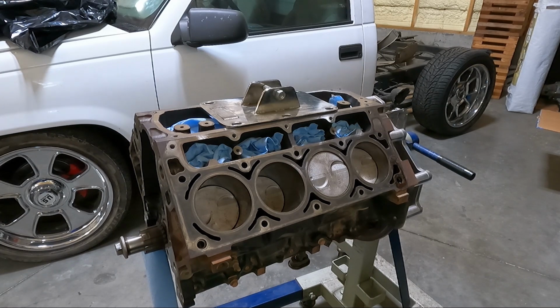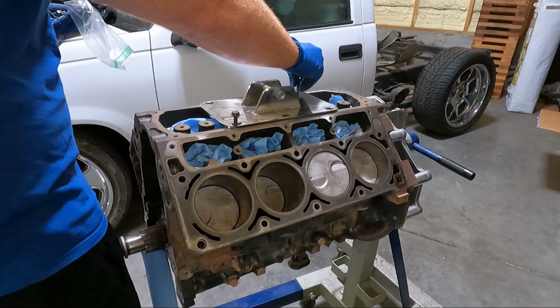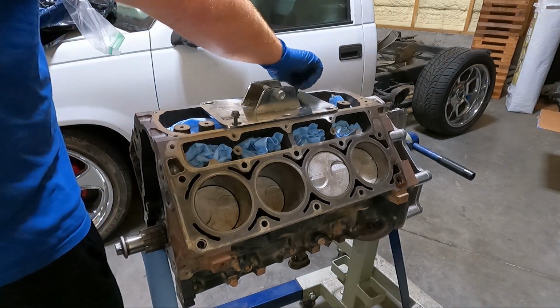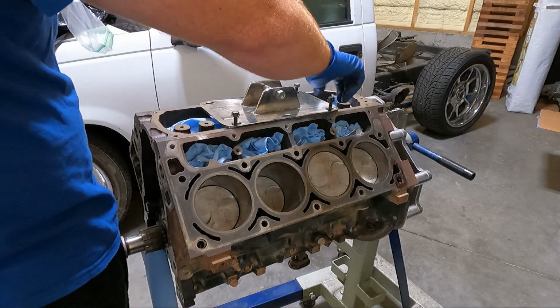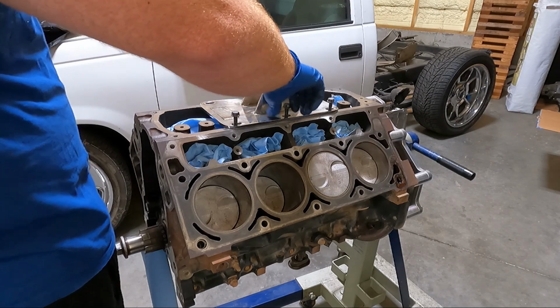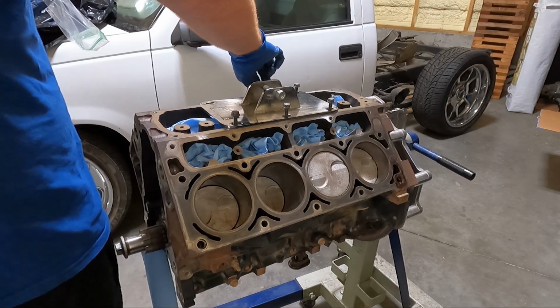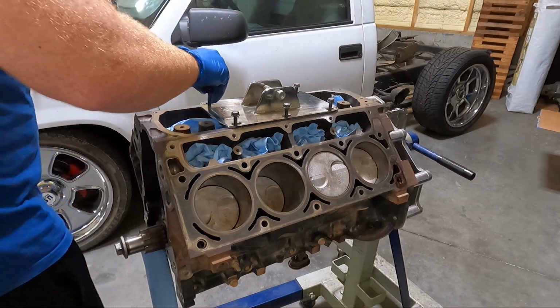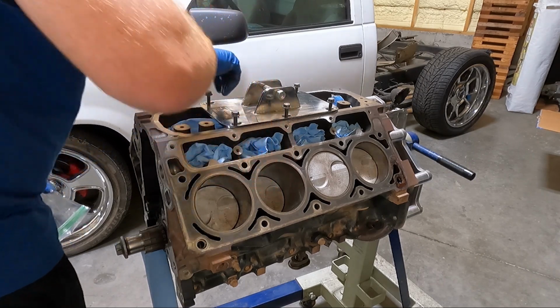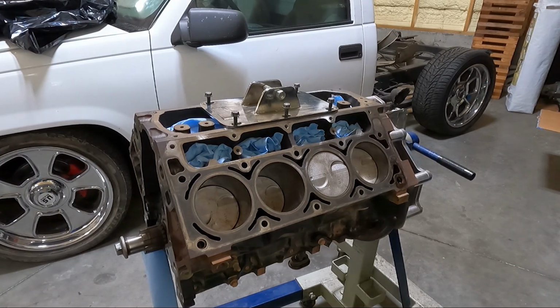Well, look guys, no engine stand works really well with getting the rear main out, or the rear cover off. So what I've got here is my LS lifting device, and I don't even think this company makes them anymore. I'll list one in the description down below, but it may not be the same one. There are some different variants of it now that go a little further and have different hooks on them. But this one's always worked well for me for both installing and removing motors. We need to get this off here, so we're going to tighten these up, lift this thing off, and spin it around and get that rear main out.